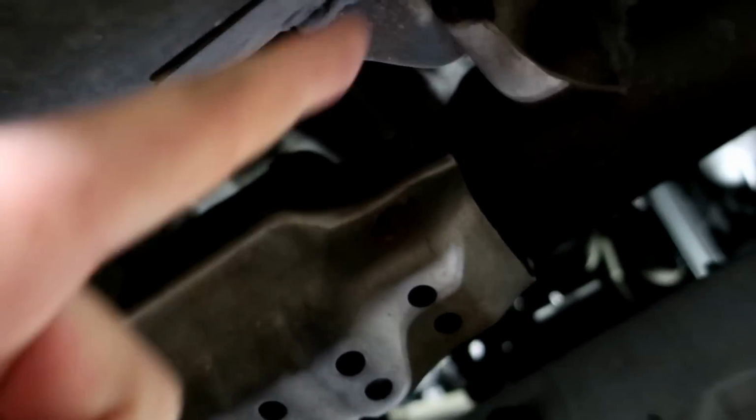I gotta take it off here. I gotta undo these bolts to undo this piece here. If I got the 3 bolts up there undone, I've undone the flange that's up top of there, and I've undone the dampener up top. But I need to get these 2 bolts out here and the 2 bolts out there for this to slide down.